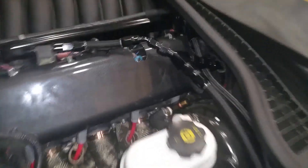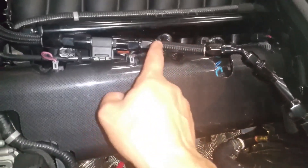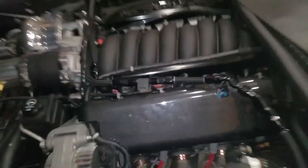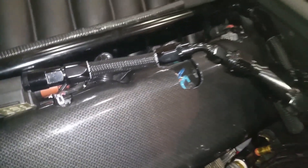And there is the finished product ladies and gentlemen. I just had to notch it — actually took a while, I always try to notch as little as possible so I kept coming back and forth to test fit. It has about an eighth to a quarter inch clearance. I'm going to have to extend this hose about one inch to reposition it. Got to clean this motor down and do a nice detail job. Thanks for watching, have a great day, and if you click the like and subscribe button I really appreciate it — take care.